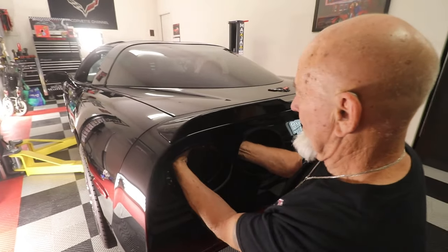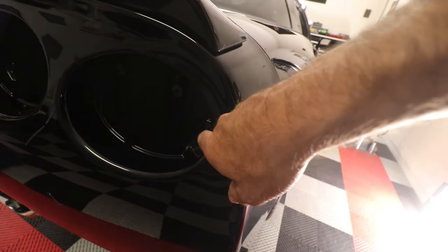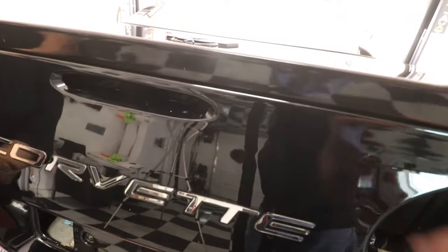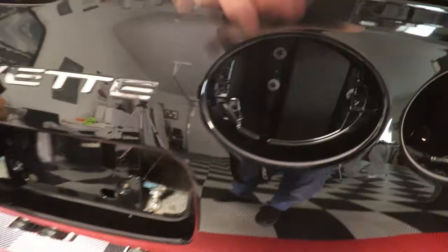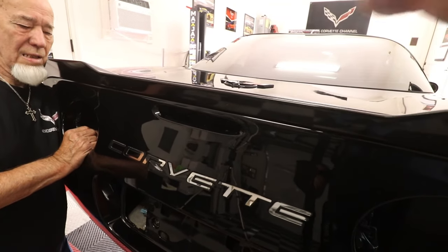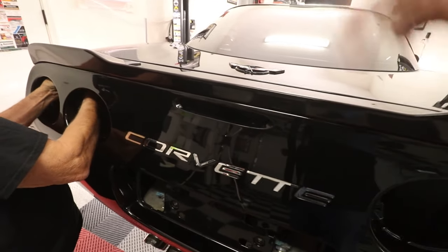While Terry's tightening these up, let me explain how to take these tail lights out. The tail light has a screw here as well as here on both tail lights. What a lot of people probably don't know is this third brake light - in order to get to that, there are two screws pointed downward. They're eight millimeter and you can reach them through this side or the other side where Terry's hands are. You'll feel the plug, unplug the wire from it, and you'll be able to pull it right out the back of the housing. That way you're not drilling into the third brake light.